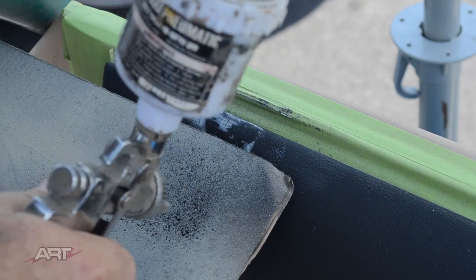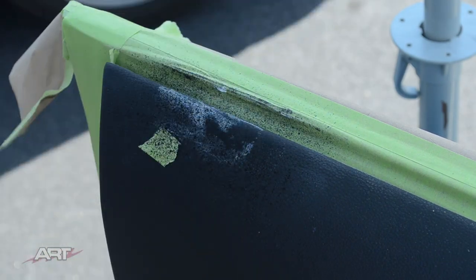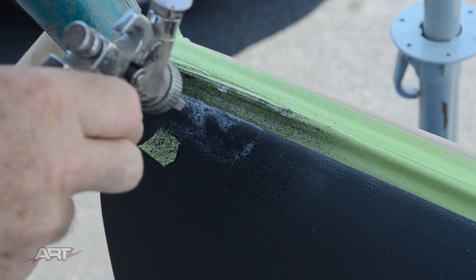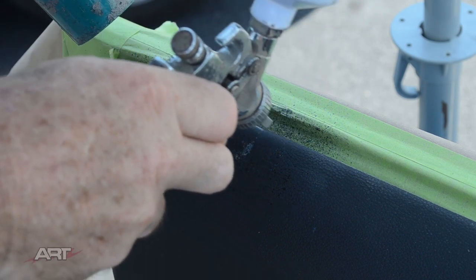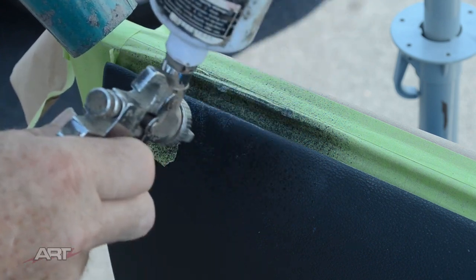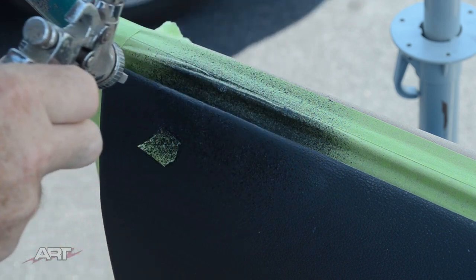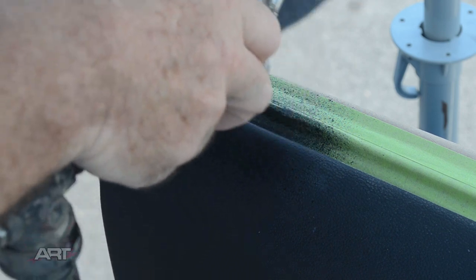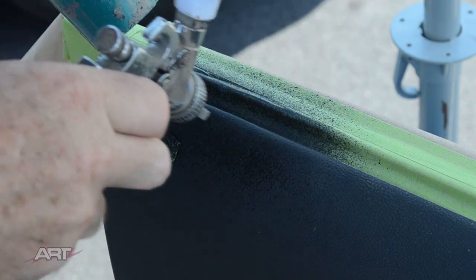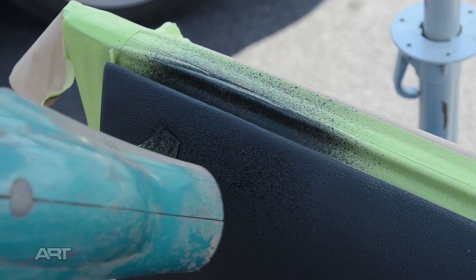Now what I've done, I've matched the color and I have fortified what would be my leather dye with some plastic primer so that it's a little bit more rigid of a coating, not so soft of a coating. The purpose of this is so that each texture droplet wants to stand up and remain firm on its own. And because the heavier droplets tend to be shiny, I am adding a flattener so when it's dried, it dries down to the sheen of the door panel.